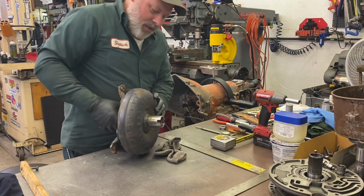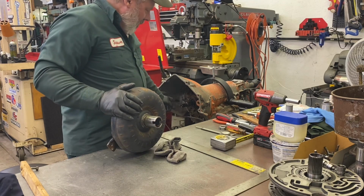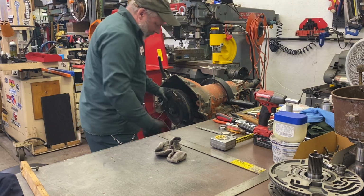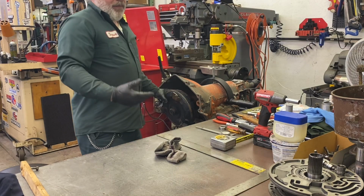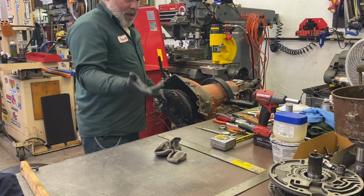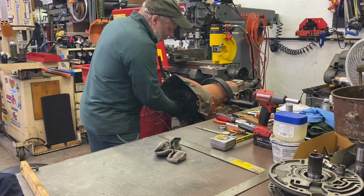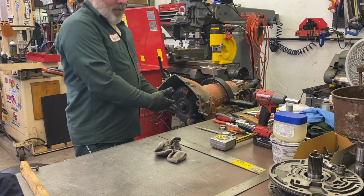So I like to get it up onto the input shaft, and you can rest it there for a minute while you get into position. Let's just do that. You don't have to line anything up. Just set it over there. We're not anywhere near the seal or the pump yet. Don't put your bare hand on the hub because it could have a sharp piece. I'm wearing a glove, or use a rag. I like to grab here and grab one of the converter lugs. Just ease it on there. We're already on the input shaft. You heard the stator, and then you heard the pump gears.